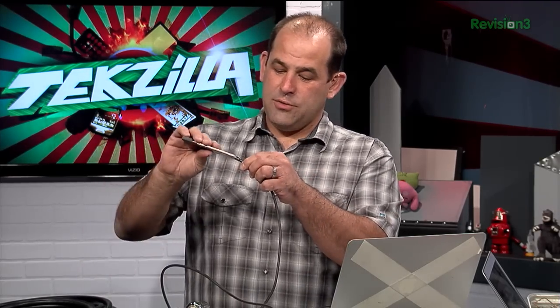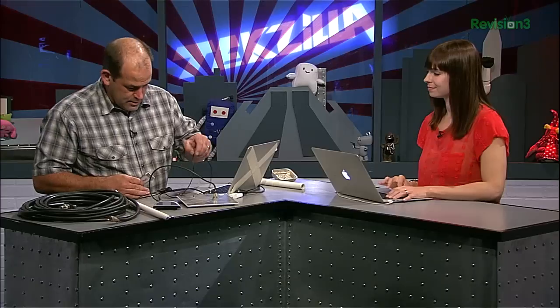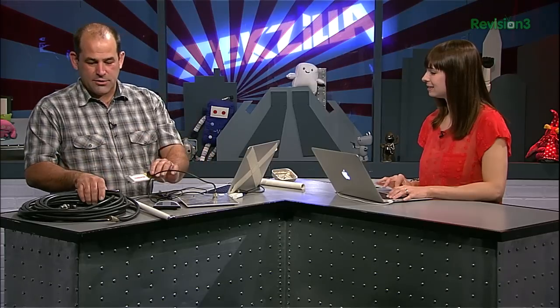You're also going to need the proper pigtails to attach everything, because one connector type will not attach to another, which means you need the right pigtail adapter. And you'll need special cable — do not use leftover coaxial cable from your cable TV install for Wi-Fi. You need LMR 400, microwave-grade cable. Without the right cable and connectors, all of the energy will be dissipated in the cable before it even reaches your antenna.